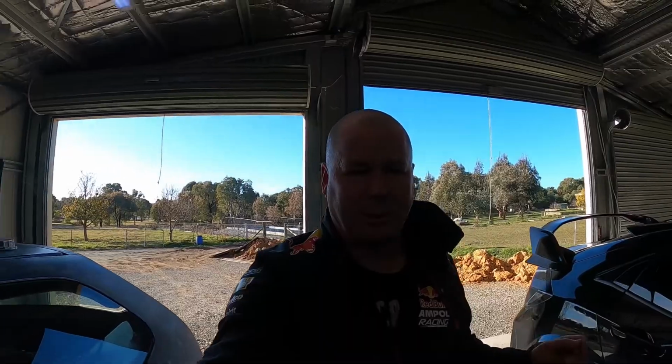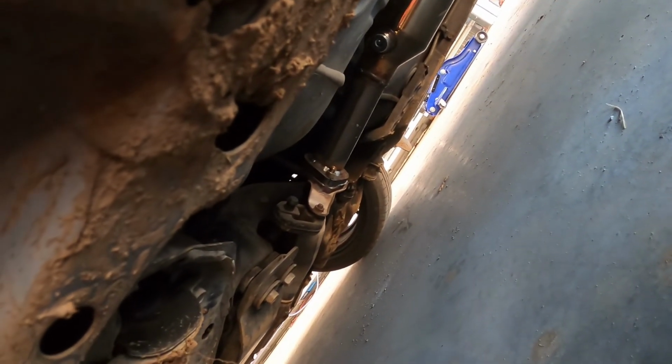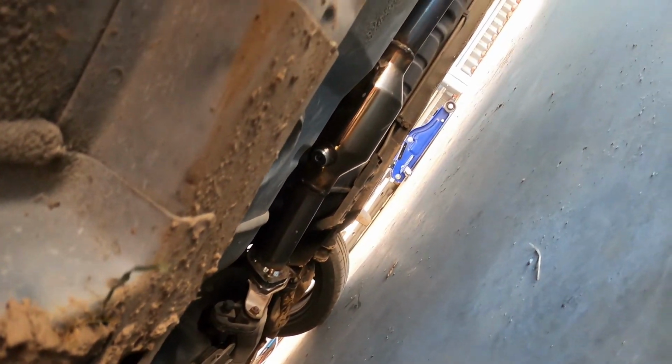So these Mirages have got a terrible little factory exhaust on them. You free up a bit of horsepower with these little exhausts. So we've gone with a steel system, not stainless steel, so a mild steel, full 2-inch system, high flow cat, and then just a small little red-backed muffler on the back. We'll get underneath, show you a look. So we've gone all the way to the flange of where it comes down from the exhaust manifold. There's our 2-inch system, with a beautiful high flow cat. That 2-inch, look at that mild steel and a bit of coloration there. Seen some high temperatures, Fred Jr.